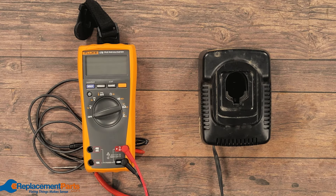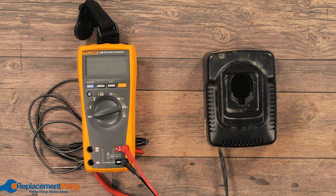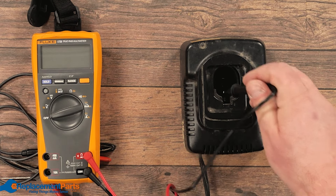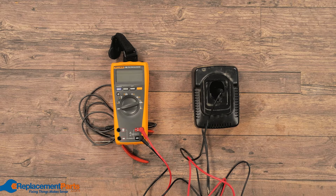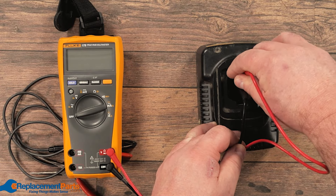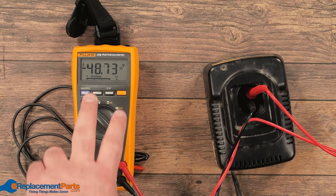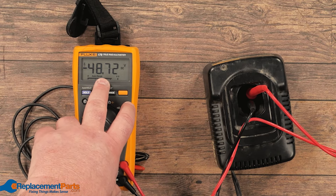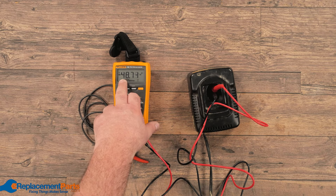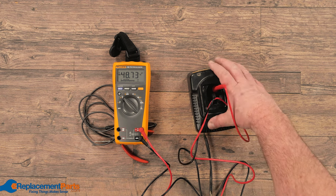To do that, we use our multimeter and plug in our charger. Knowing that this is now live, we have to be very careful because we are dealing with AC. We take our probe and shove it all the way into the slot, as far down as we can, so there's no exposed metal. Repeat with the other probe into the second slot, turn on our meter, and we can definitely see we do have voltage coming across the meter. It's showing negative because we have the probes currently reversed — it doesn't really matter. It's definitely showing we have a working charger.